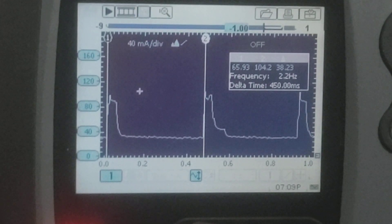The lab scope sees it but the digital multimeter does not. The meter bounces around a little but doesn't tell me what's going on. A 100 milliamp draw will certainly kill the battery within a couple of weeks. What we've got is a high-amperage pulse occurring on a regular cadence that's not showing up on a multimeter.